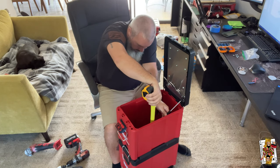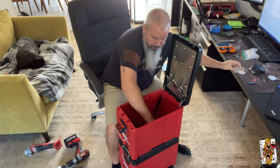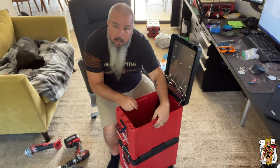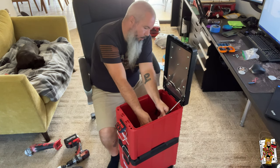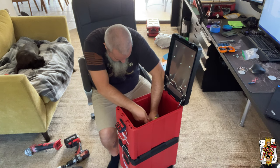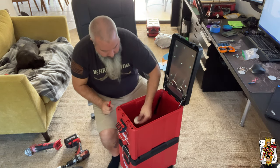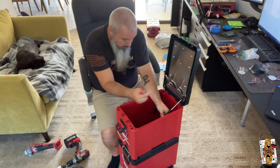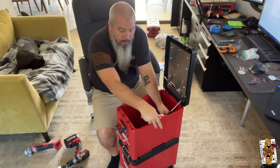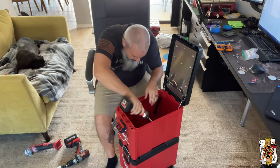You want to be three inches from the top lip. Get this where you want it, take your tape measure, get your top plumb, and it basically says the center of the bracket needs to be at least three inches from the top. Once you get one where you need it, mark your hole. There are backing plates - this backing plate is so that the plastic doesn't tear out. Make sure you're far enough that the plate can sit on the outside and not cause a problem. Make sure you have a three-inch reference line on the inside.